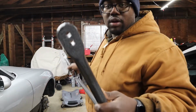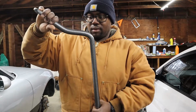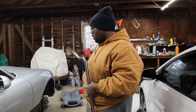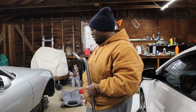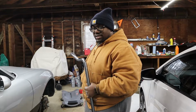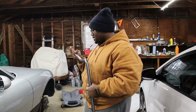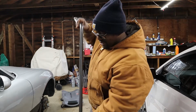As you can see, this sway bar is pretty beefy. When I get the OEM ones out, I'll be able to go in depth about the thickness of this piece. If you don't know what sway bars do, pretty much they help the car with turn in. You can get a more technical person to explain it, but from what I understand, it's about turn in, and they minimize body roll a little bit as well. As you're turning, your camber is going to adjust more with OEM stock, but when we go to the track with these upgraded sway bars, we should see less camber, be less affected. I don't know. Anyway, it's going to help us out though.